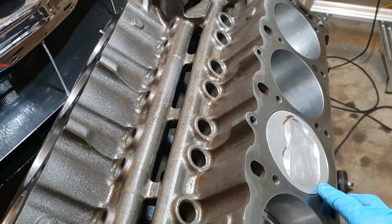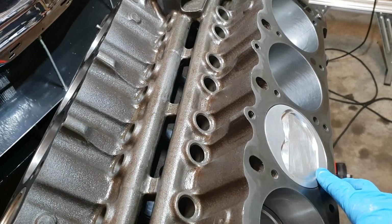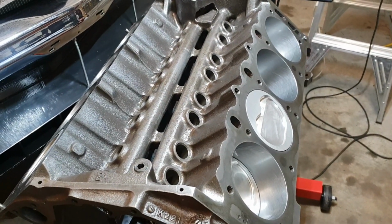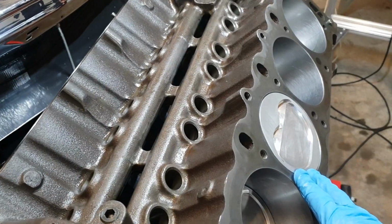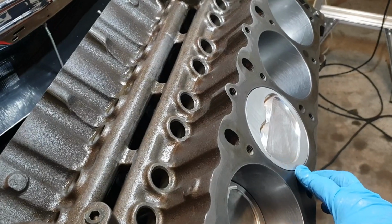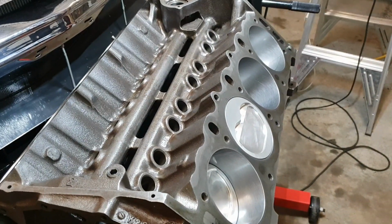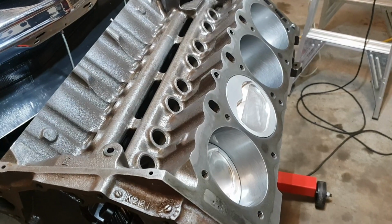It feels, when I put a feeler gauge on it, when it's on top dead, it's around 5, maybe 6 thousandths down the bore when I do my checks. Well, this one, because we bought a new piston, was sticking out around 5 or 6 thousandths out of the bore. So we needed to take off roughly 12 thousandths to match the rest of the pistons.